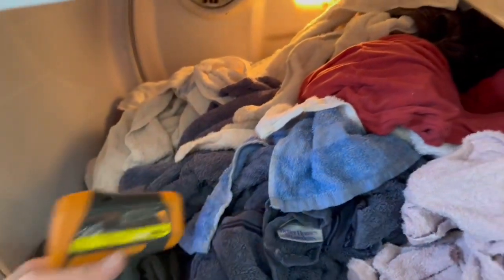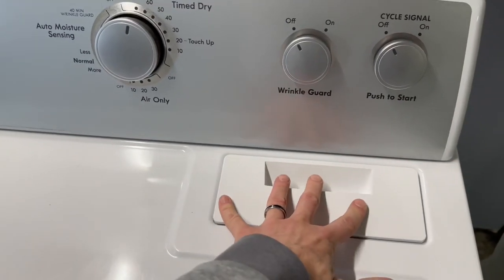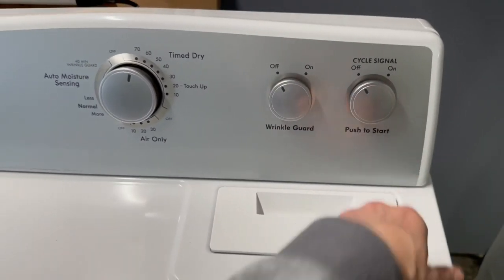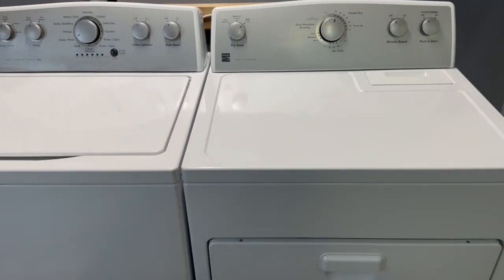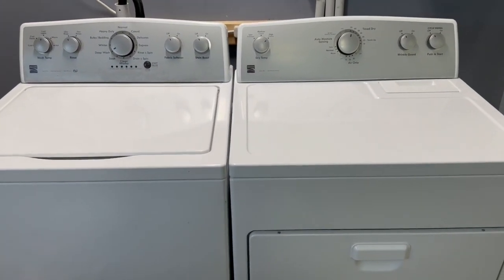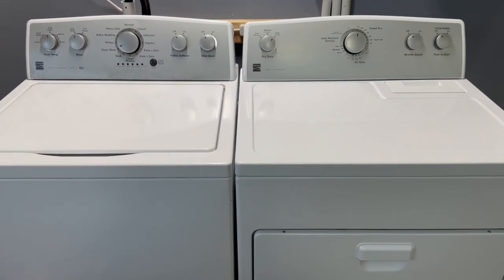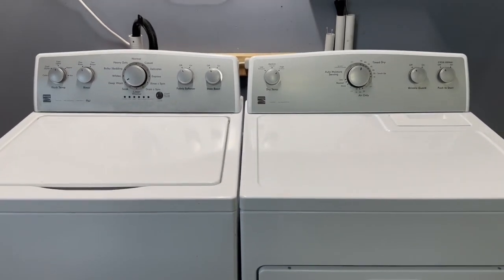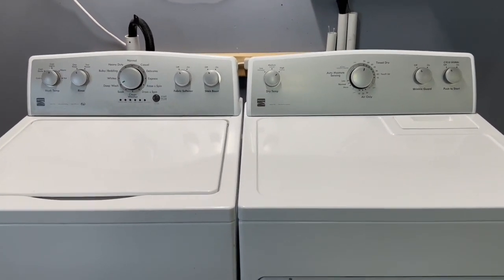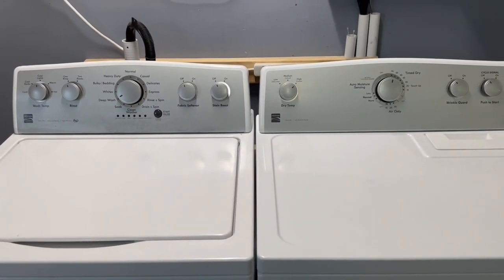The little grate right here gets pretty hot so you know it's actually heating. Air circulates with the clothes and exits right there, which is where the lint trap on top catches the lint — then down and out the back of the dryer. You want to make sure the lint trap is clean and cleared before each load for sufficient airflow and no blockages. All that contributes to fast drying time, especially when the washer spins those clothes out fast — that's part of the high efficiency, the HE designation. If you have any questions feel free to reach out. Thanks for watching — have a great day!